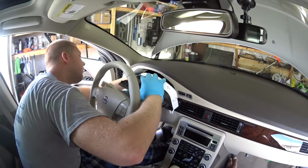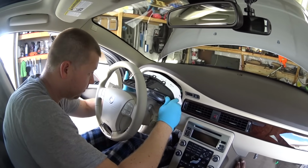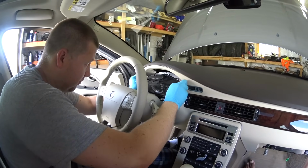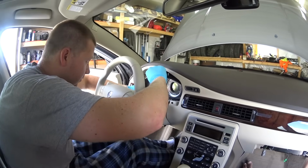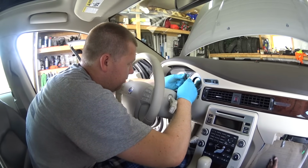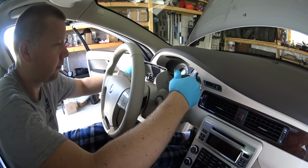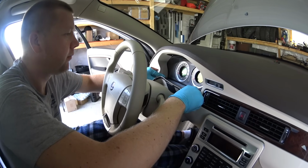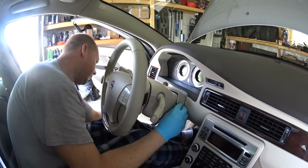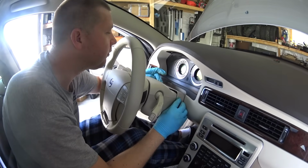Speedometer cluster, carefully, make sure you don't scratch anything. Don't forget to reconnect the connector, and that's how you drop it in. Reinstall the 4 screws. Reinstall the decorative trim around the speedometer and the steering column.